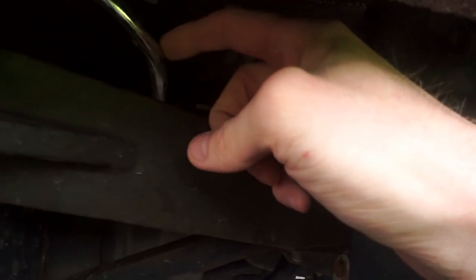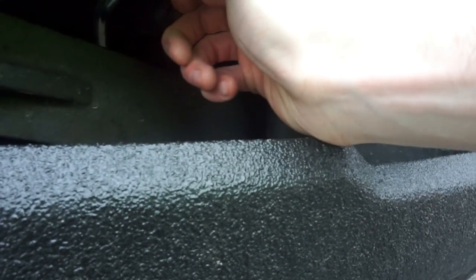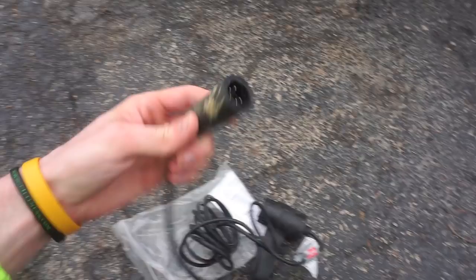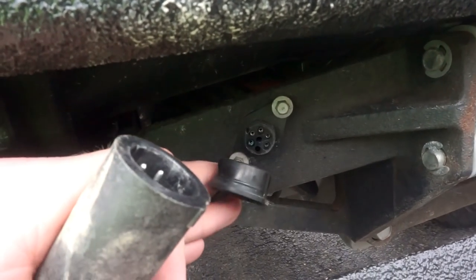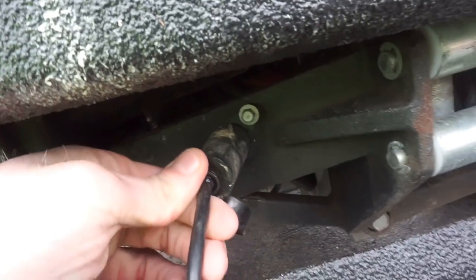So now we're gonna take that clutch here and we're gonna turn it all the way back to the right and you'll feel it lock in. Okay, so now it's locked. And then don't trip over that like I almost did. All right, and then now, here's your winch controller, here's the plug-in, and here's the controller unit itself. We're gonna take this, and there's a cover right here. You're gonna pull that off. You see right there? Boom, boom. You get the idea? It's as easy as plugging that in.